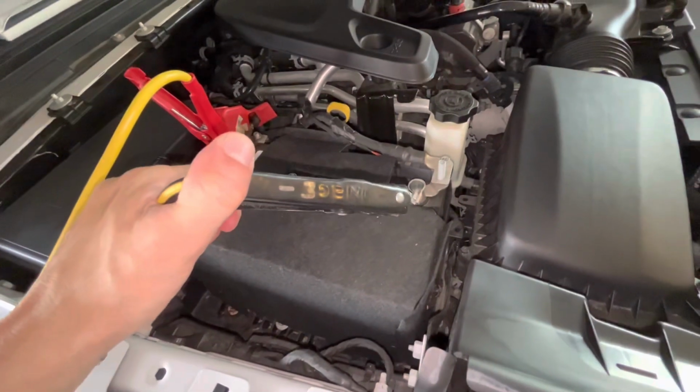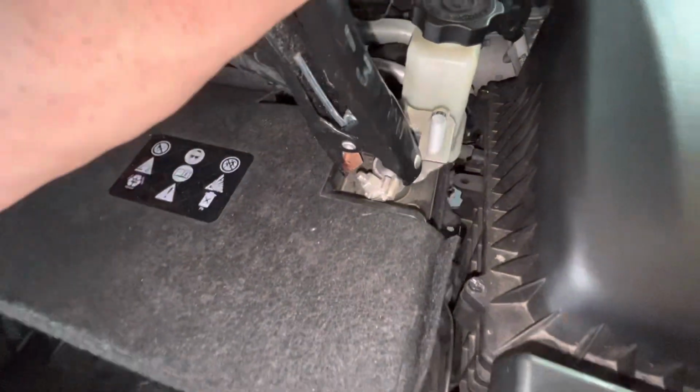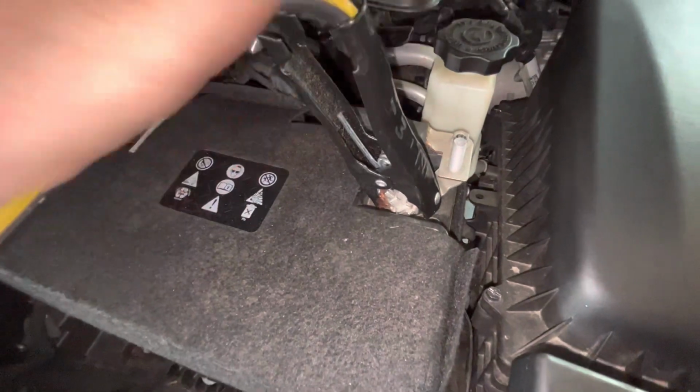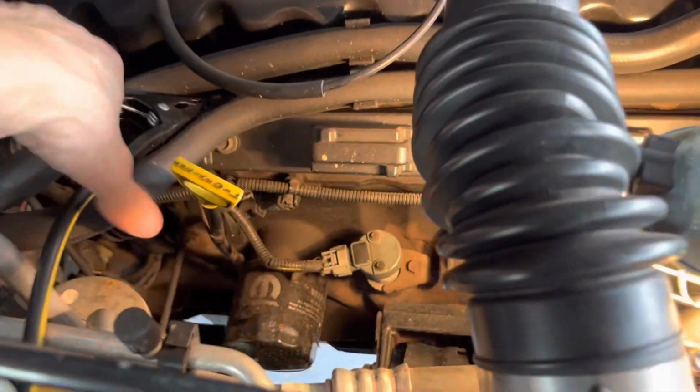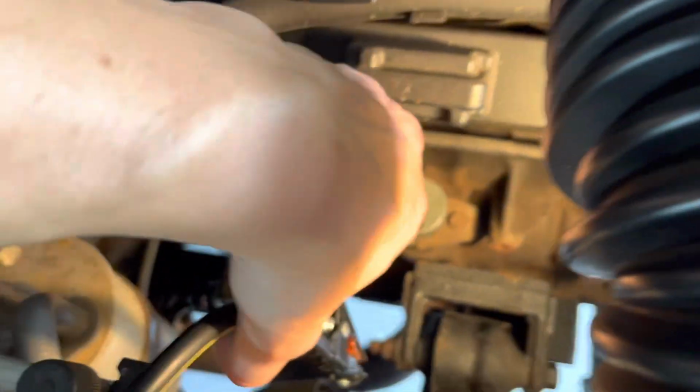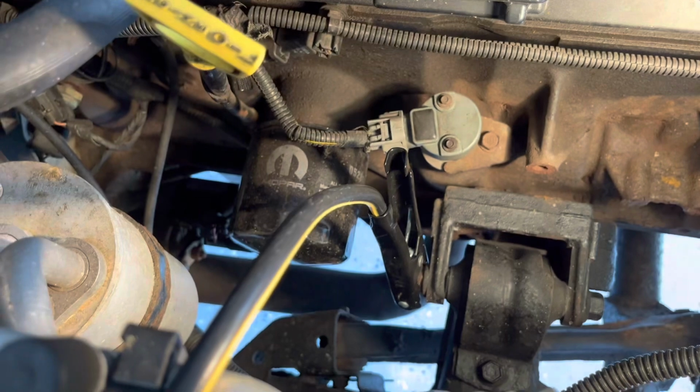Now, every battery is going to be labeled positive and negative, but usually it's indicated by black wires and red wires. Match black with black and red with red. And the last cable, lead number 4 that we labeled number 4, has to be grounded. Now, you want to find a non-painted surface and connect that. This will help with not shorting anything out.